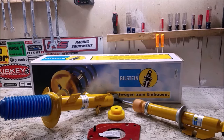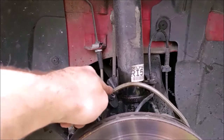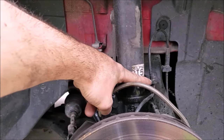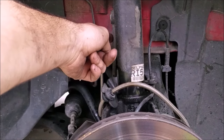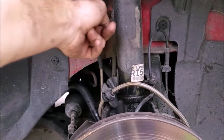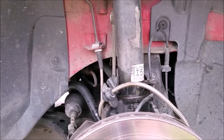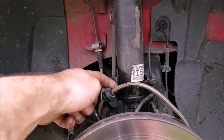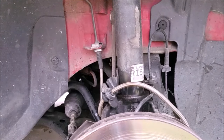Looking at the front damper, there are three things to remove: the brake line held here, a speed sensor here, and the sway bar end link in the back — 16 millimeter nut. Pry these out; it's easier if you spray everything down with penetrating oil first, which will help slide the rubber bushings out and ensure you don't snap the pinch bolt in the back.